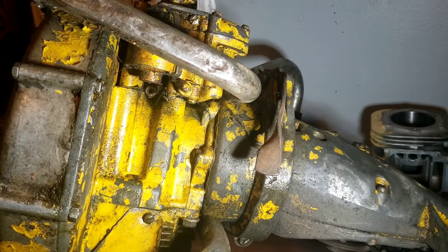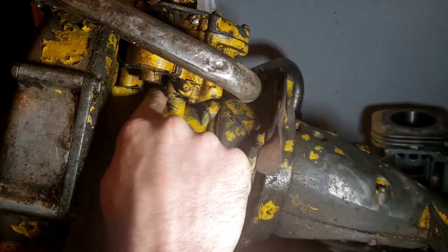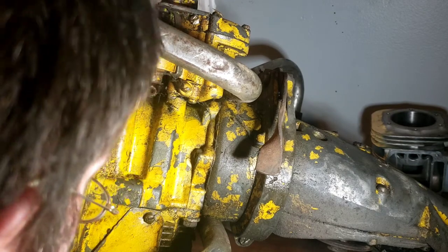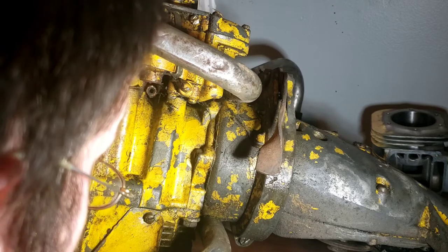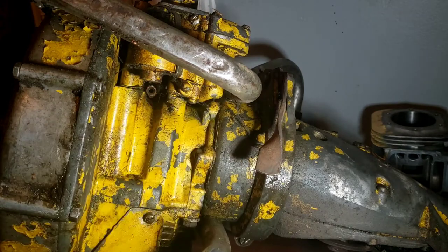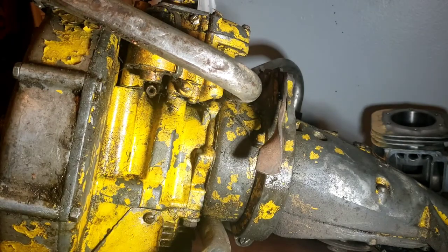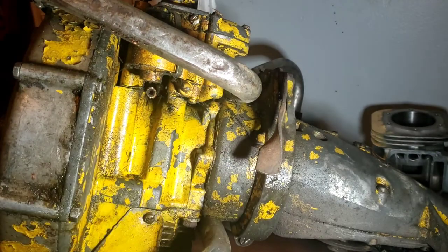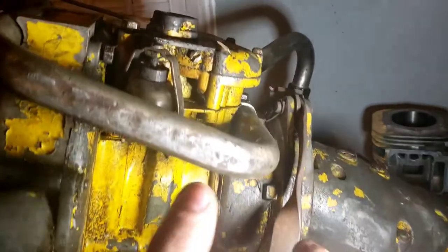So the line is completely rotted. So we're going to have to get the fuel tank off and stuff anyways from the looks of it. Do barb fittings and stuff, that's going to be another fun one. Kind of figured the fuel line wasn't going to hold up after all of these years. And it just completely severed itself from the fitting. Yeah. So, anyways. Well, now that we're going to be super careful because of a fuel line, let's get super into it, shall we?